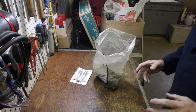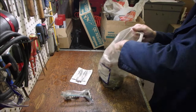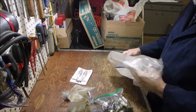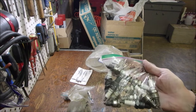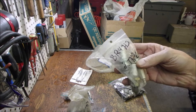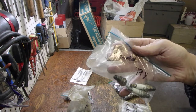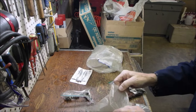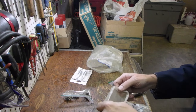These ones are recycled spark plugs, and they've all been tested. This is more of the Honda line — there's a few torches in there. BPR 4 HS came out of my buddy's old generator. These come out of the small-throated chainsaw — 79Y or equivalent. And then this is just like the little CJ 8s and CJ 7 Y's and stuff that are around — more of the older saw stuff.